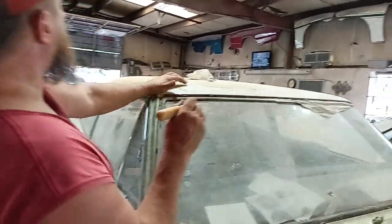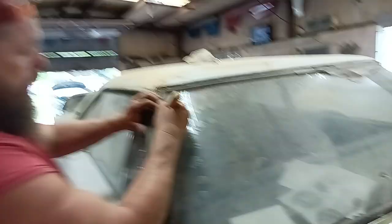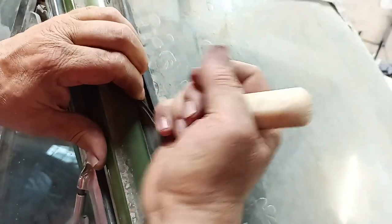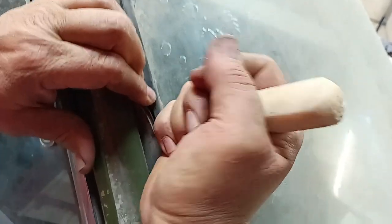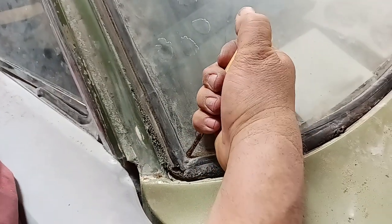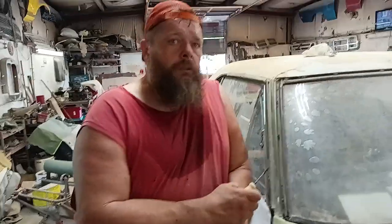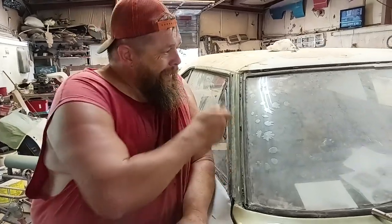Most later model cars like that El Camino or the Camaro back there just glue in. But on these older ones, take your time. Like on this Dodge — unzip this. See, it's got a zipper, and when you get it put together, you rub it down with oil, press the zipper together, and that tightens up and seals the glass. Once I get this zipper unzipped, I run my screwdriver back under here and make sure it's loose from the glass. Then I'm willing to put on coveralls, combat boots, safety goggles, welding gloves, and get inside and kick that windshield out to save this rubber.